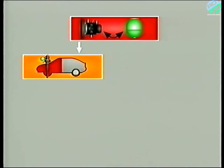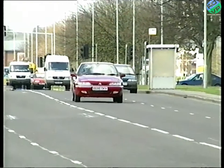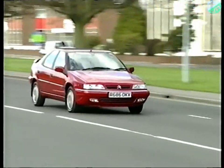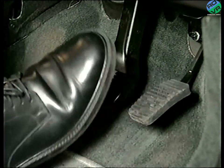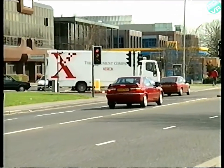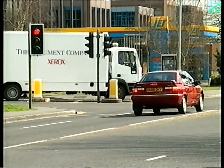Our source and reserve of pressure directly feeds the front and rear suspension. The dual circuit braking system, split front and rear, draws its energy from the high pressure supply circuit. An important point to remember here is that the braking system is power braking, not servo assisted. The effort required to stop the car is generated by the system, not by the driver's leg muscles.